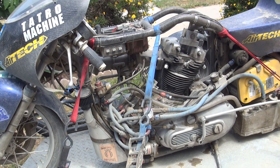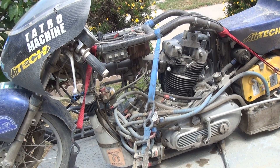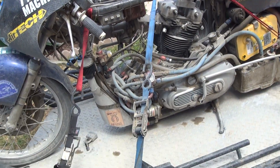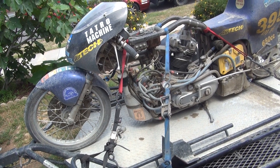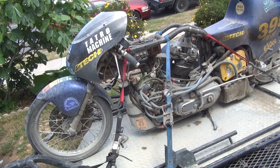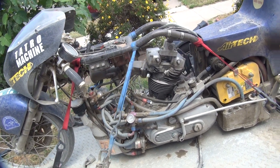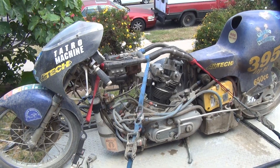At the other end of the track, the motor was not too happy about it and quit running a little bit — got about 80% power loss, like it was locking up, lost about 500 RPM. Then it recovered and I picked up another 200 to 250 RPM back before I went through the traps. Still, it only came back to maybe 50-60% power. When I tore it apart, there was a lot of blow-by — all oil blowing past the rings — so the rings are obviously not seated. But anyway, that's what happened on that run.